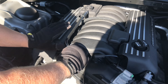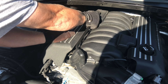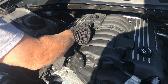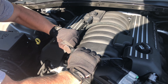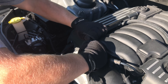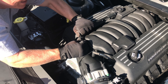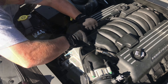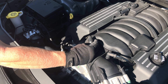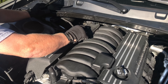This is what the catch can replaces. On this end you'll pull it off with the rubber insulator, which will be very tight. This end the elbow is going to stay. So get that out of there — it's a tight fit. Just give it a turn and it will pop out of there. That part is going to stay, and then we got to get this part off too.